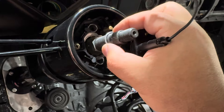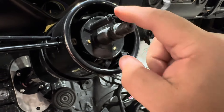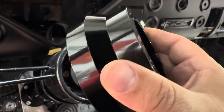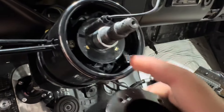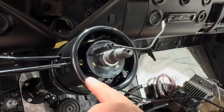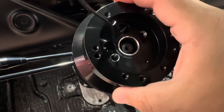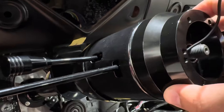They then give you the spacer, which goes over the shaft. Then we have our actual hub adapter — this is for a five-to-six-bolt steering wheel, it's aluminum billet, black, and matches what we're trying to do here. These all come in different configurations, depths, and sizes. A good idea would be to have a couple of spacers on hand in case your adapter makes it sit too proud or too flush, where it will bind with the column itself or have too much of a gap. This spacer works perfectly so long as I do not use that spring. I slip this on over the wire. It sits on there nice and flush — we've got a perfect gap right there. No spring at all.